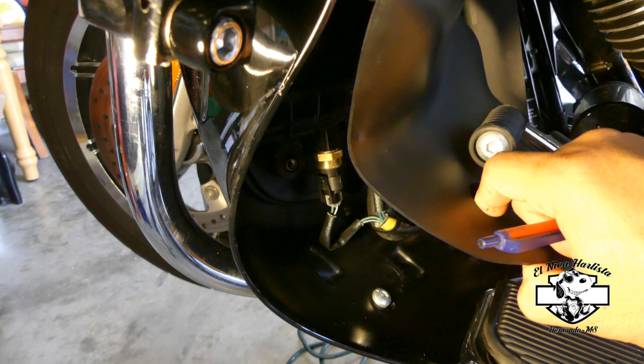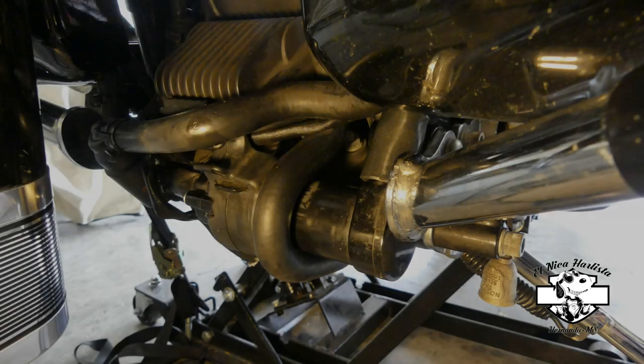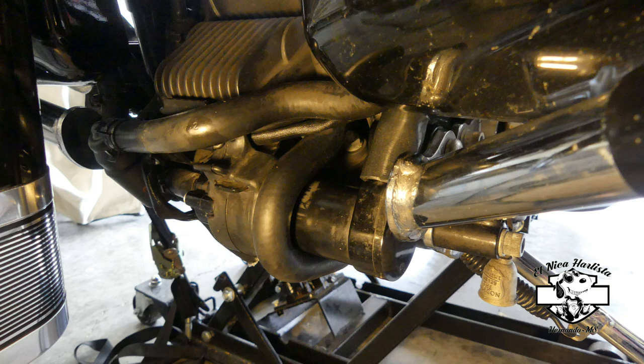On this picture, I'm showing you the location where your ECT sensor goes, which is on your left-hand side. It goes right on your left radiator. And that's where your sensor is. On this next video, I'm gonna show you the location of your thermostat, your water pump, and your junction connector, which is number 232. Also, I'm gonna show you some of the bad design, in my opinion, more like flaws. I think Harley Davidson could have done better when rerouting water hoses and the location of the connectors.